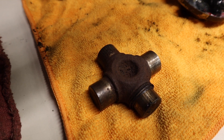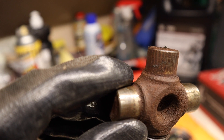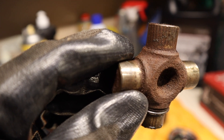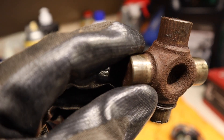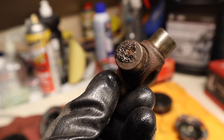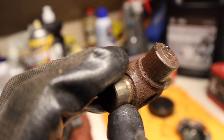The drive shaft would not twist in a vise. Once this was finally removed, one of the trunnion joints — the one at the top that I've zoomed in on — was seized a lot. The one on the bottom was seized a little bit. You can see that even after a lot of penetrating oil and heat, this one was what was seized and not allowing the U-joint to have its proper function. Once I sourced this and changed it, all problems were gone. Here's a better look at the other sides — you can see how clean they are. The top one was very nasty.